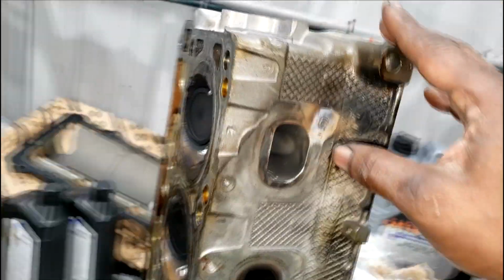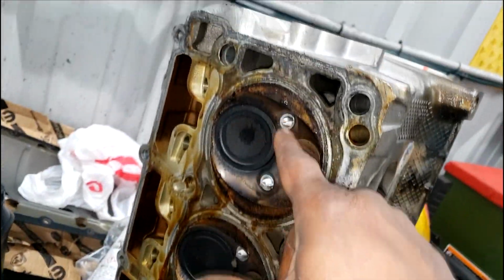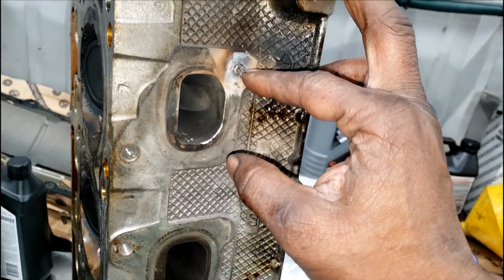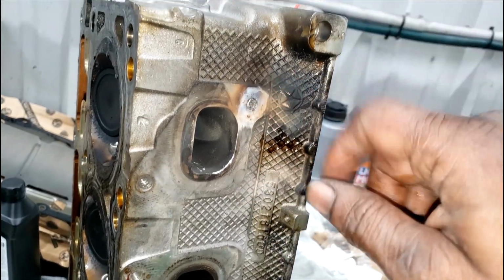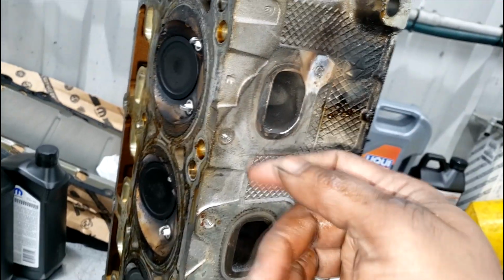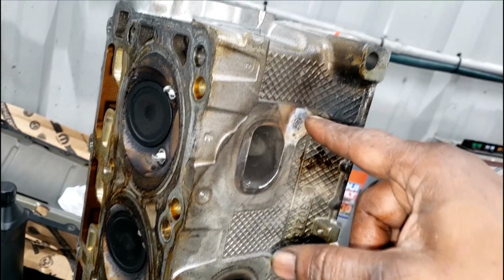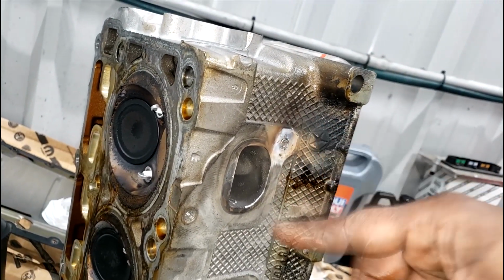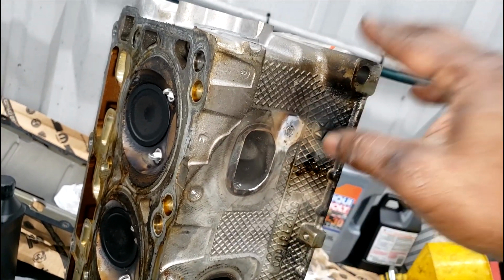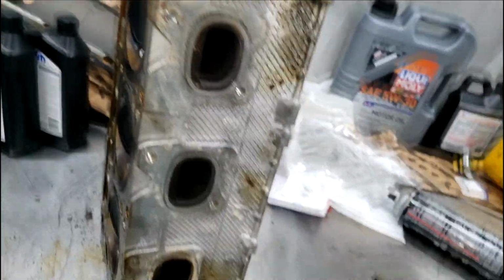So as you know, it's extremely hard to come out if you go in cross threaded. Hey, it's still new spark plugs, so yeah, somebody has worked on this. When they attempted to do this job at first, they likely went in, and I don't even know how that's possible. If you're fortunate enough to get it out, the threads are still there. So I guess you should tap or use a thread chaser to clean out the old threads, blow it out, then go in with the new studs. But how do you go in crooked? Well, anyway, that's what we're suspecting.